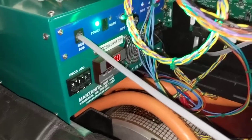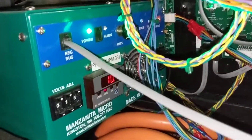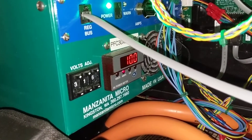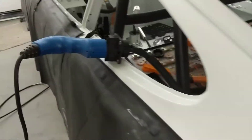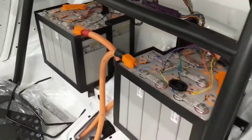Now I'm actually running the charger — you can see it running at 10 amps, and I've got it set to 316 volts, which is the total battery pack size. All the cards are functioning. I've got my thermometer there so I can test and see how warm everything's getting, and I've got the typical J connector plugged in, so I'm happy with that.